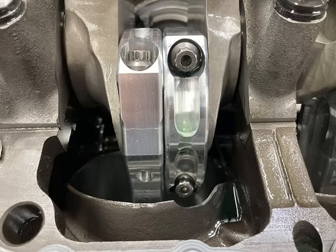You generally won't see these with a big long stroke. This one used ARP 2000 bolts. You can see that I had to notch the cylinders there, to let the rod bolts clear the cylinders.